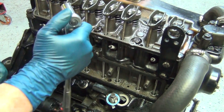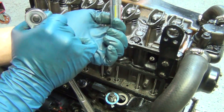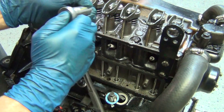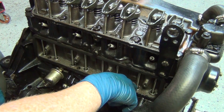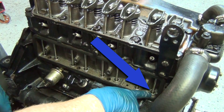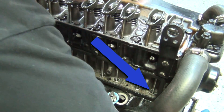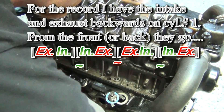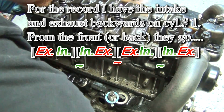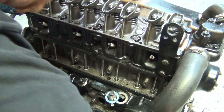I'm going to watch these go up and down, and basically use a 16mm socket. I've got mine marked out according to the square parts — yellow on one side, red on the other. What you're supposed to do is bottom these out to basically where they seat into the lifters when they're not being influenced. You can see this one is being pushed up — it's higher than its neighbor. As I turn it, watch that go up and then back down — that's the intake. Now the exhaust will go up and back down.